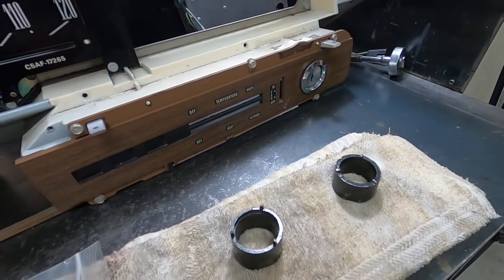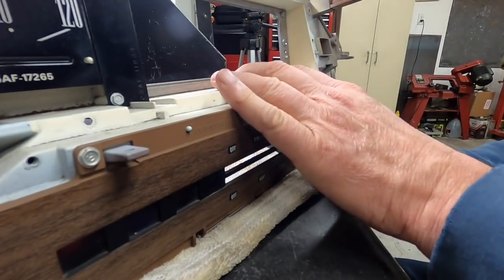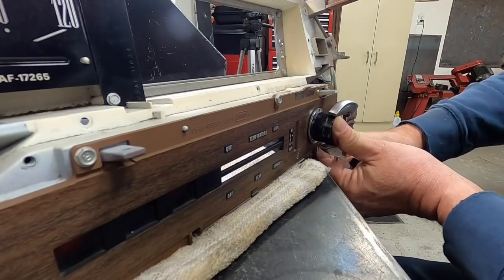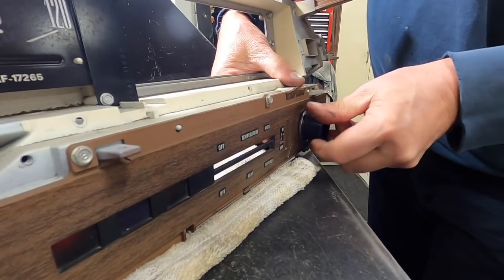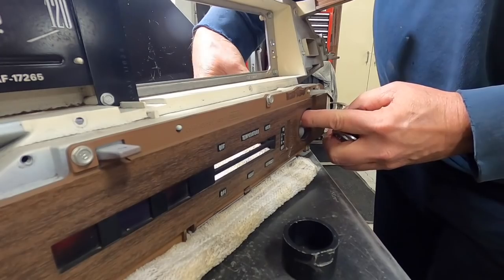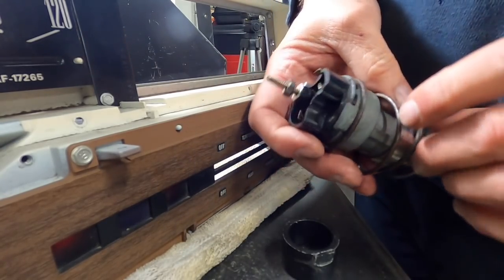So I'm going to get that out right now. This tool — you can use a big wrench, there are a couple of flat spots on there. So there, that just turns it. That's probably loose enough to where I can turn it with my fingers. Then I'm going to hold the ignition back because this is spring-loaded in the dashboard. When I let go of it I can push it back — so I'm just holding it. And that removes the ignition switch. It needs a little cleaning up — that was a brand new switch; look at how dirty it is from working on the car.